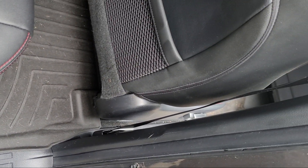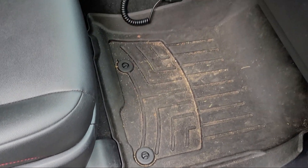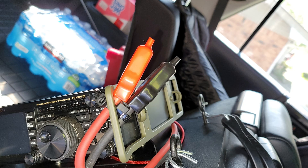The only wire I left out on top of things is a flat network cable — CAT 7, I think — that you can use as an extension for the microphone on this YAESU radio, with an adapter to hook the microphone in. That will stay there semi-permanently but could be quickly and easily taken out. You barely see anything, it's all black, and it doesn't bother her. I also put a couple of additional rubber boots on the ends of the power leads and set them up with a zip tie scenario to help keep them separated.